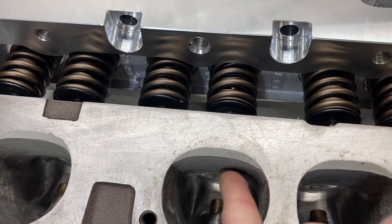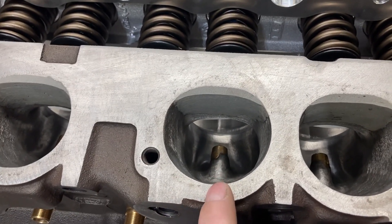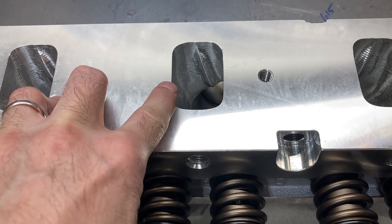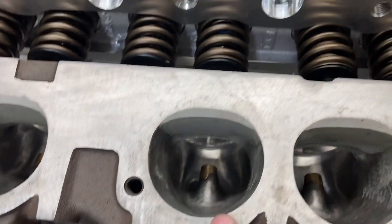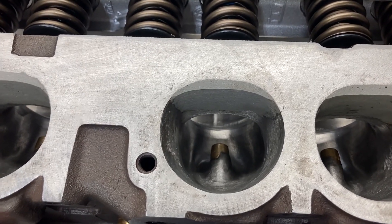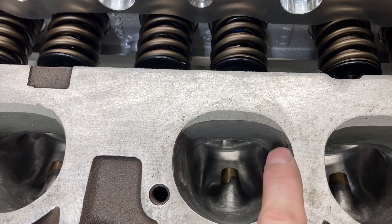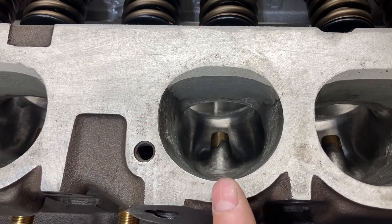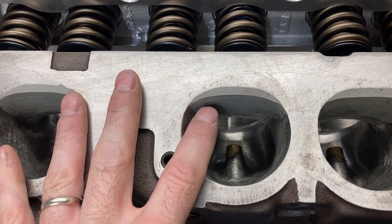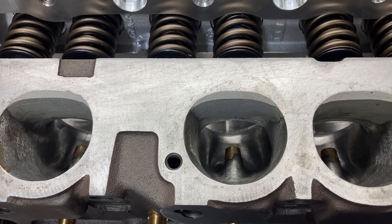As part of our porting process we actually make the port smaller. You can see we've put some epoxy in the floor of the port to make it smaller — this is necessary for higher flow. These heads flow around 380 cfm. The tunnel port is a 330-ish CFM intake port; this Trick Flow is a 380-ish intake port. We generally make them smaller to get to that point. Without epoxy in the floor, these heads will pretty much bottom out at 340–350 cfm and get real turbulent after 0.625–0.650 lift. As they sit now, these heads will support well over 0.800–0.900 lift, and it's the epoxy in the floor of the port that accomplishes that.